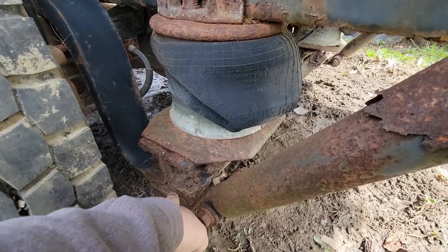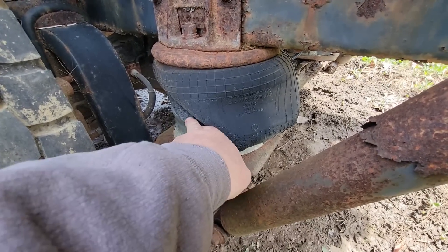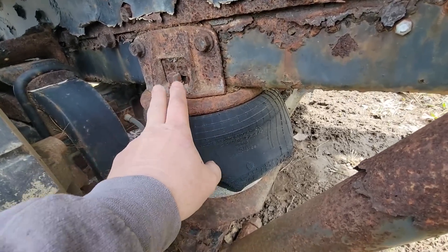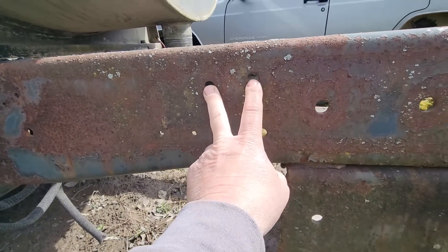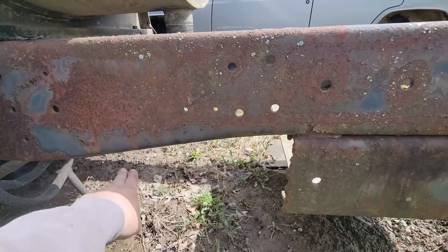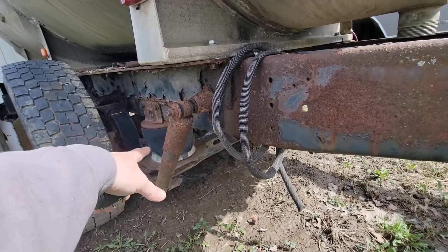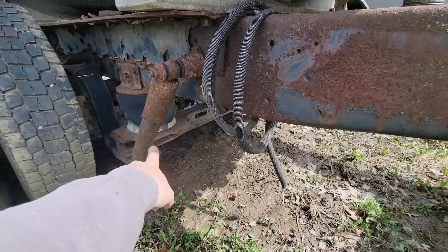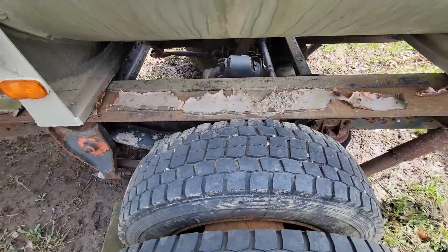The shock is moved way back here too. The axle has been moved forward on this one - the front leaf spring hanger and bump stop are shifted, and then here's the airbag mount. This probably shortens things up at least two inches. Since that was pushed down farther, when aired up the pinion angle probably wouldn't be right. That bar would need to be changed and adapted to get the right ride height, so I don't think this is going to work.